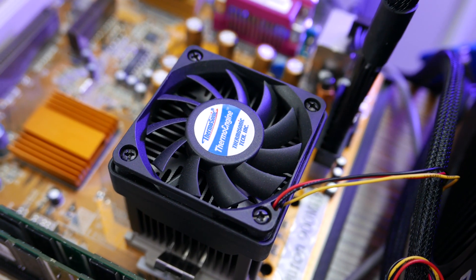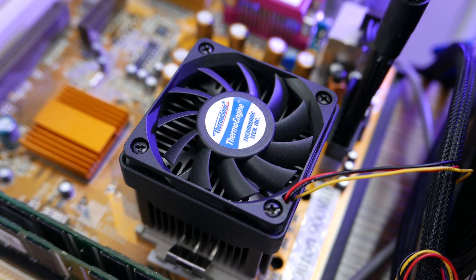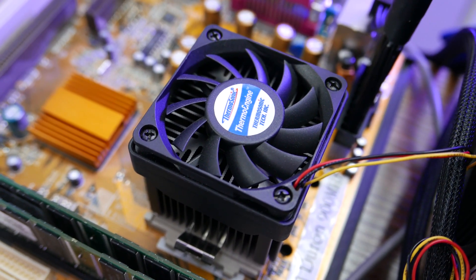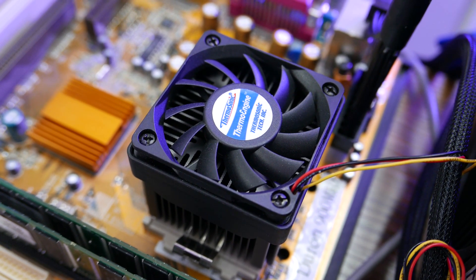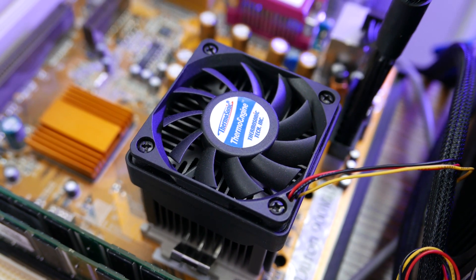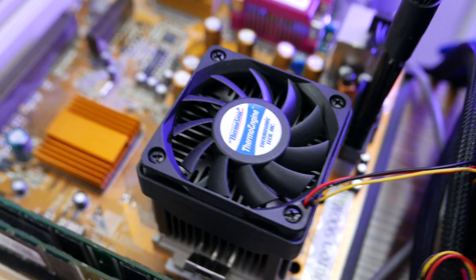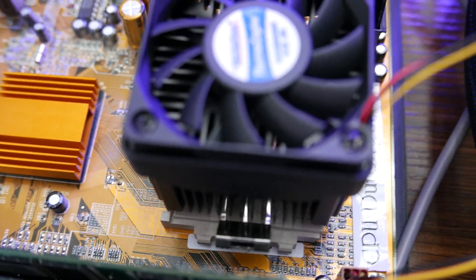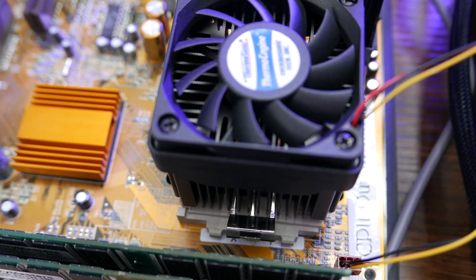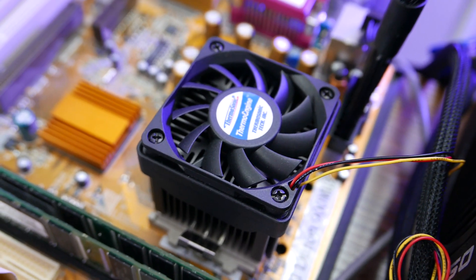Before I go — don't ever buy this cooler. There's a bunch of them floating around on eBay and they're a scam. It does operate as a cooler, it's definitely got a thermal cap, but it can't handle some of the hotter running chips. Also, the way the mount is designed, it's basically guaranteed to destroy one of your Athlons at some point. If it doesn't destroy the Athlon, it's going to destroy the motherboard when you try and remove it. Don't buy this cooler.